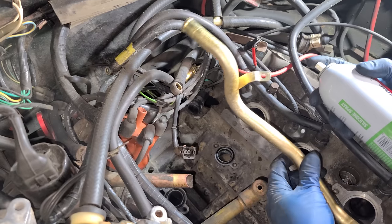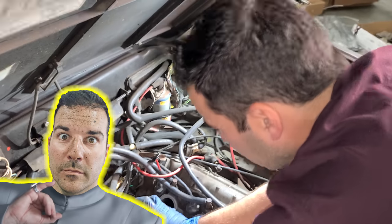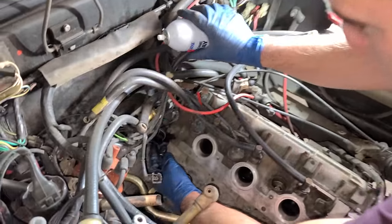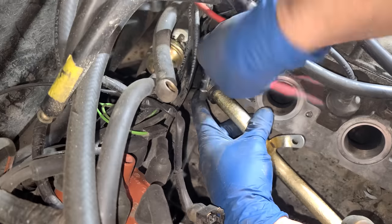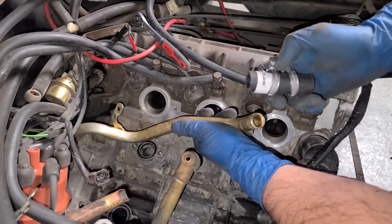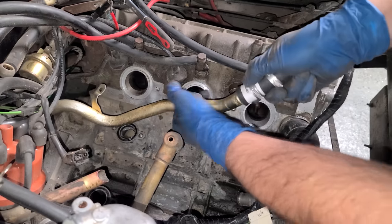Before our aluminum Y-pipe goes in, we need to put in our gold coolant pipe. It's worth $1 million. A little silicone spray on our new hose. Okay, there's that. And we'll tighten up our clamp. There we go. Normally I take stickers off of hoses, but this one says DMC, or at least DM and then half a C, so I'm leaving it.